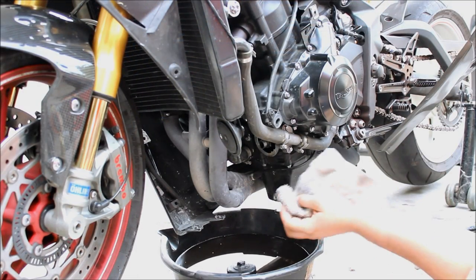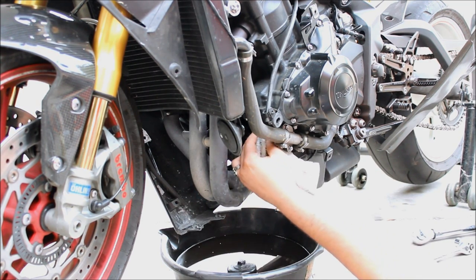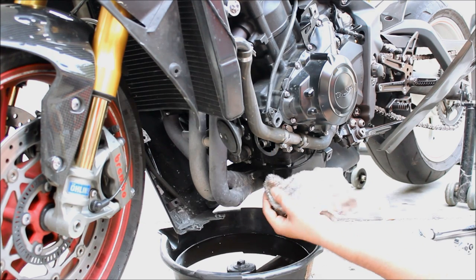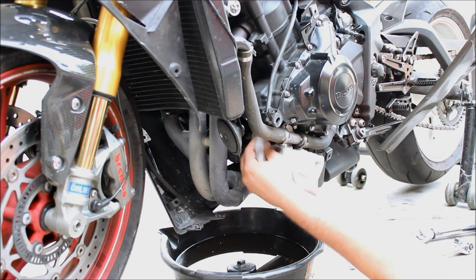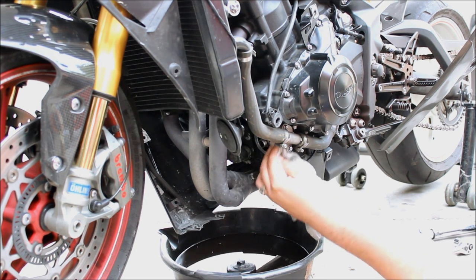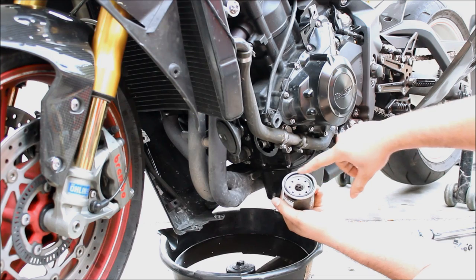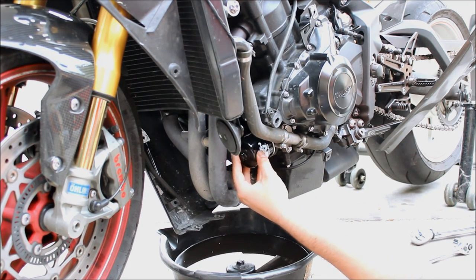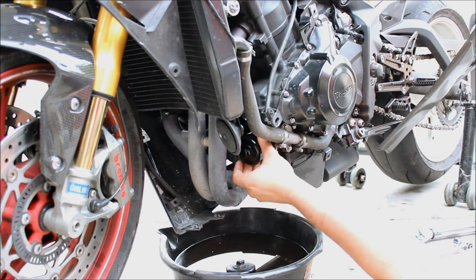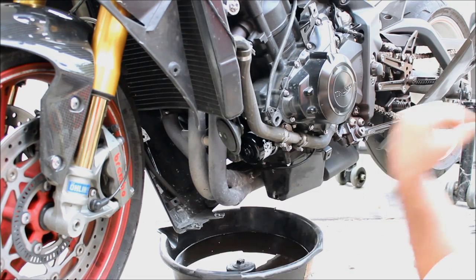If you look at the mating surface of the oil filter, you want to ensure that this is clean. Make sure that the old rubber gasket that was on the old oil filter isn't stuck on here — sometimes it comes off; it's rare, but it does happen. Also look at the threads where it screws onto and make sure they're not chewed up. So with the oiled rim, we're going to stick this on and just screw it in place. A lot of people like to put a lot of force onto this — it's really not needed. So like right here, it's snug, just go that much, we're good to go.